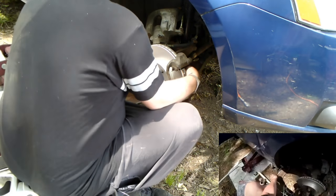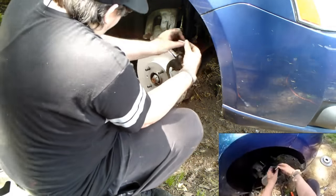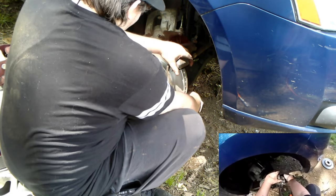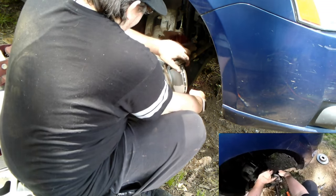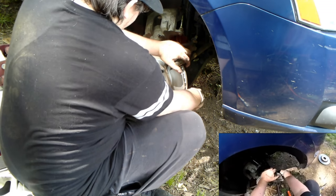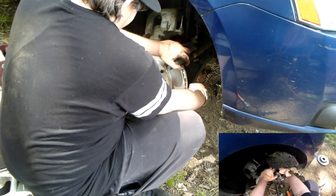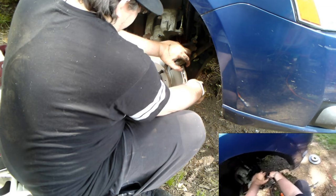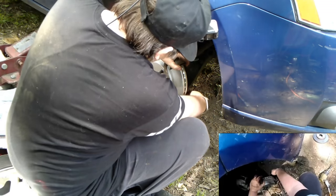So I don't think it's going to keep your rotors from rusting in the car that you drive. Let's say you drive 1,000 miles, burn the coating off, and then park it for a couple of days or weeks. It doesn't take long, the rotors will rust. The Pontiac, I did brakes on it recently and it's sitting over there with rusty rotors already.